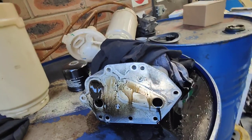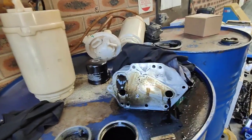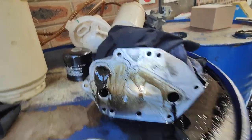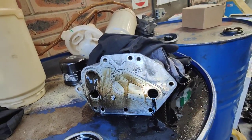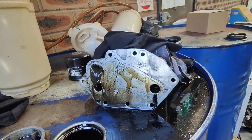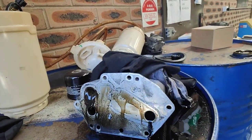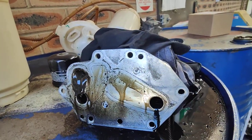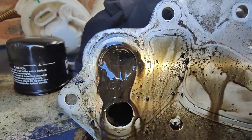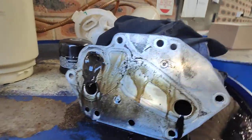So at this time we have pulled the gearbox cooler out. You only have two oils that you've got to worry about: the engine oil cooler, which is this one here, and the actual automatic gearbox cooler. So you've got to be careful — sometimes you think it's engine oil but it's actually automatic gearbox fluid. What you do is remove all the hoses that go to any kind of coolers in the engine, and then the one that's dirty is the one you've got to look at, which is just here. This is the oil cooler for your engine. It goes on the side of the actual oil filter housing on the X5, which is just here.